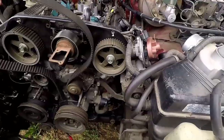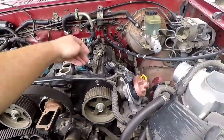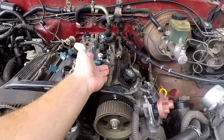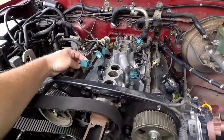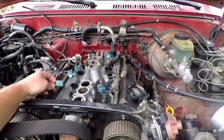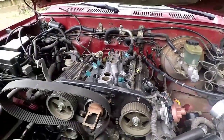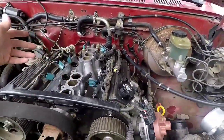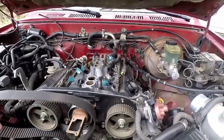So what I'm doing — I pulled everything off, pulled all the injectors. I'm going to redo the pins and connectors. I think that's what his problem was — the injectors shorted themselves out. I think that's what one of the fuel codes was. He had five of the 220cc injectors, and then one 200cc injector, so one cylinder was getting shorted on fuel.